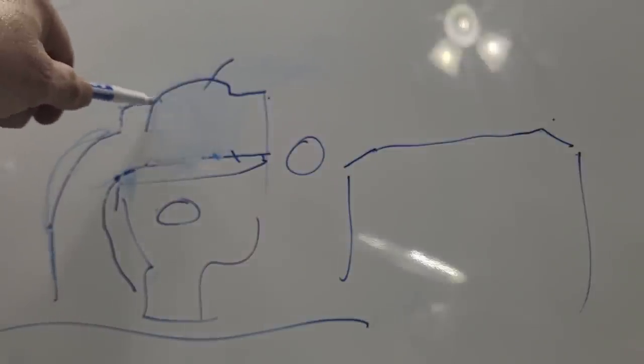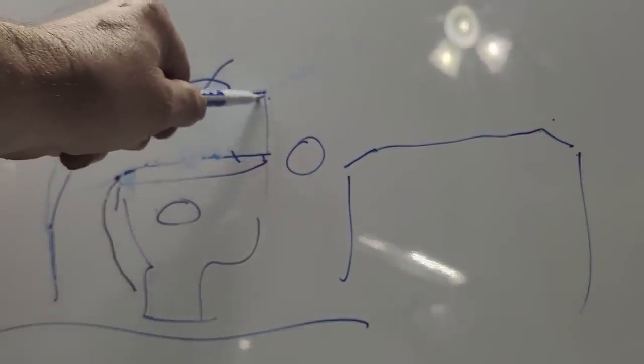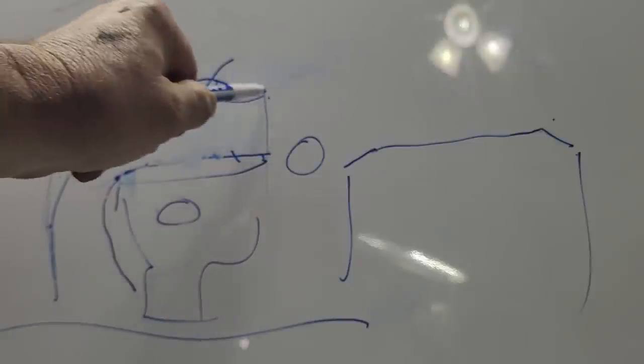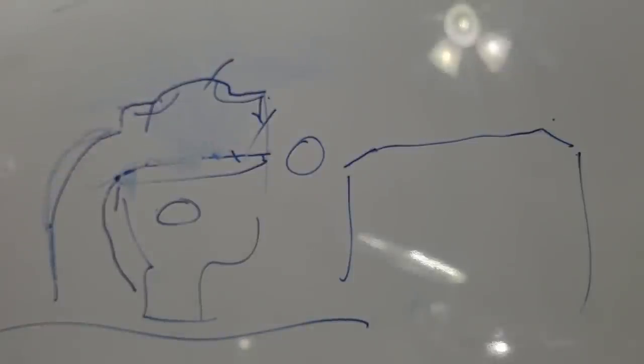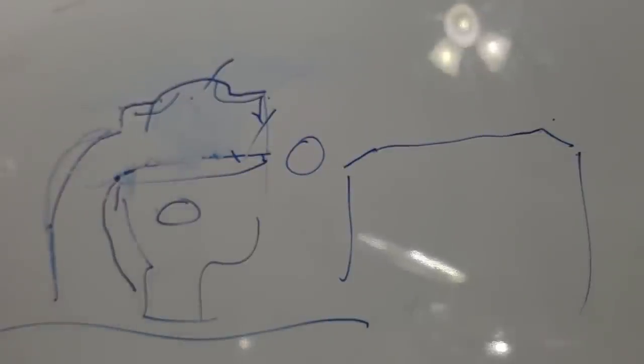How many of you have built a saw with massive compression by cutting that chamber and it says 'whoa' — but it doesn't run as well as you expected? This is your quench zone. This air has to come up in here. When the quench area is extended too far, the air doesn't want to come up — it wants to go sideways and will blow by your ring. A larger combustion chamber is necessary to make horsepower in a chainsaw at the very top. Dirt bikes work differently.